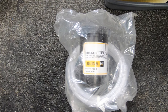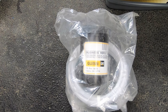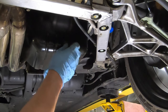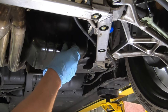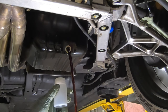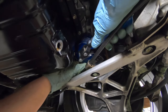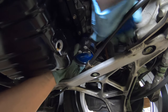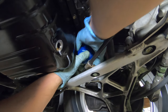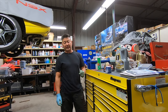Here's a quick look at what comes in the oil sampling kit — there's a hose if you want to use a suction gun, a self-addressed bottle to send in the sample, and the sample bottle enclosed within. When you go to drain the oil, go up to the plug with a 17 millimeter socket and undo it. Spin it out by hand with a pan underneath. Once the stream starts and some oil comes out, take your sample bottle, put it under the stream, fill it to the top, and your sample is ready to go.